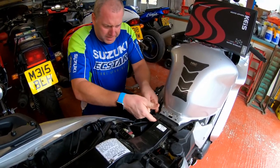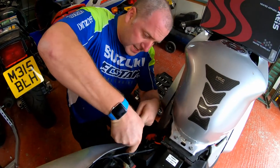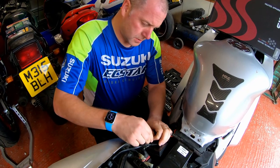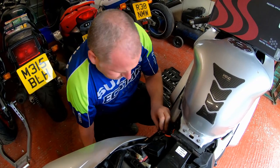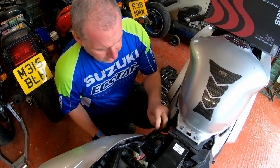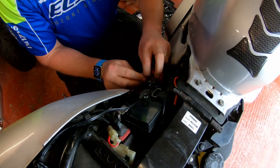Let's get into the battery — just pop these two push pins off, trim comes off, dead easy. Let's disconnect the battery. Good practice: always disconnect negative first. As you can see I've got a few things connected to my battery — obviously I've got heated grips, and I'm not forgetting the aftermarket regulator rectifier kit.